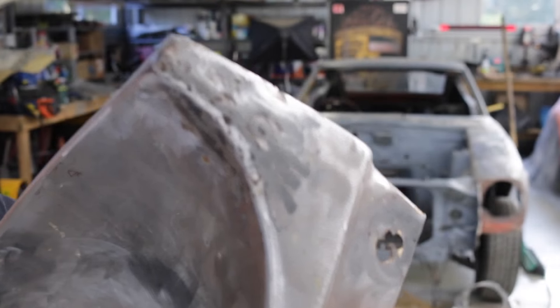After a whole bunch of cutting and welding, let me demonstrate what I was actually doing. I built this contraption. All I've got is a couple of pieces of angle iron welded together that form a nice big flat plate to spread out the load so I don't damage my car, with a hinge and a pole, and then a bit of square tube that slides over the top. This piece of square tube has a little notch in it. My idea is to get a bunch of nails and weld them to the car — they've got a flat head on them. I weld them onto the car, slot them into that piece of metal, and then using the lever I can pull up and get some leverage to pull my dents out. It's a very simple little contraption, and if it works, a lot cheaper than $500.